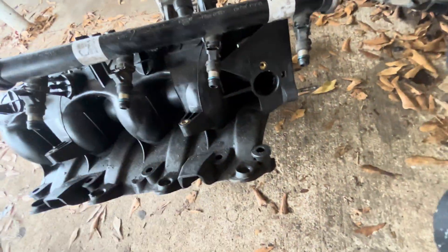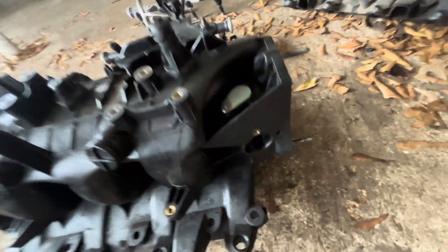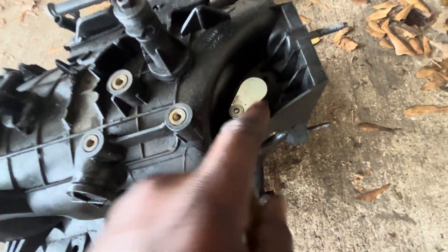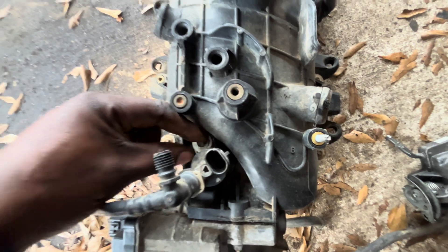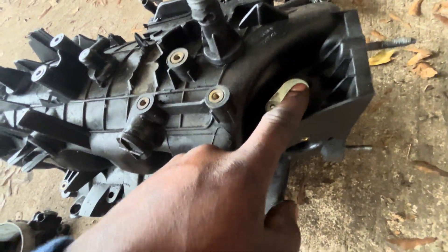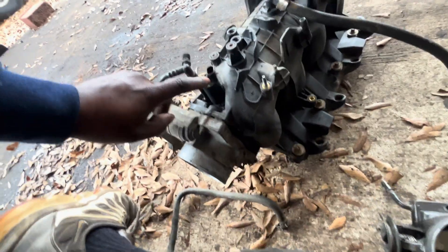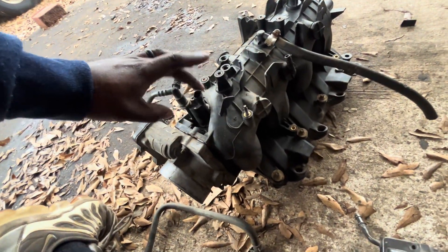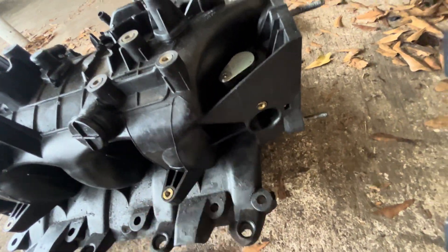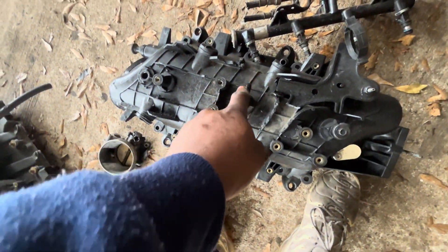If you get one that does have the hole, you've got your EGR tube running through the motor. You'll have to take that tube off. This is what's called an EGR valve delete. You take the EGR valve out with an 8-millimeter, then place a block-off plate. You can buy just the plate or both as a pair. Once you do an LS swap and get the VATS deleted, they'll eliminate this anyway.